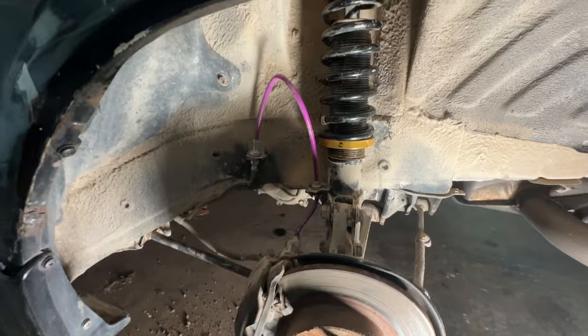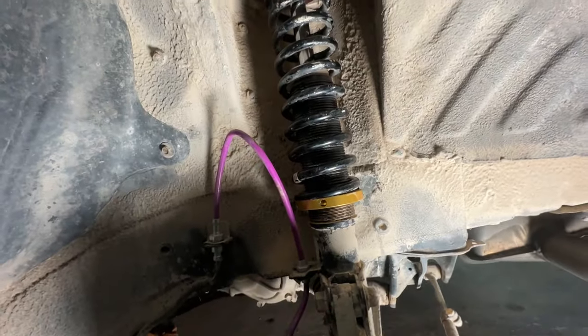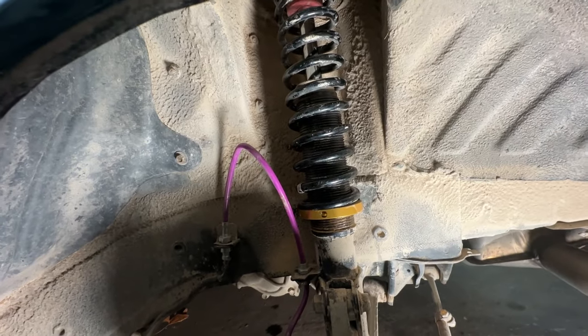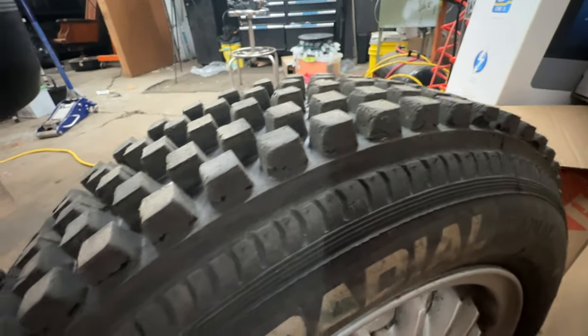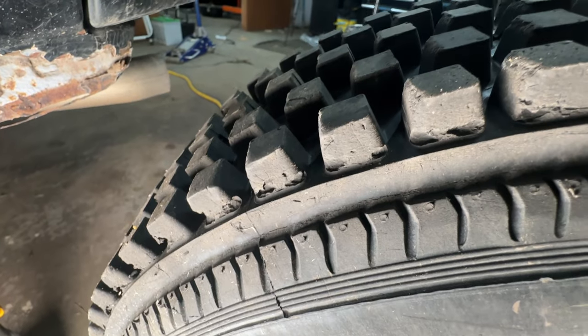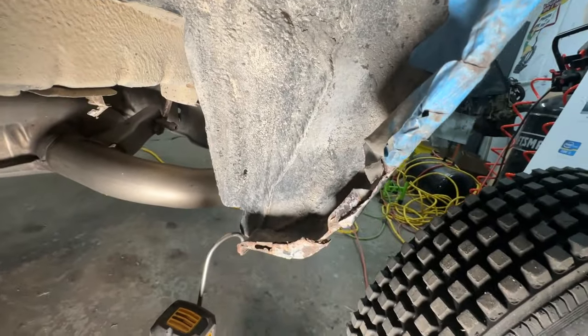Here we are at the rear of the car where we have actual adjustable suspension that will also get adjusted. We're going to dial that up as far as we can. The springs are kind of already compressed because they've got really long springs in here. So I'm going to have to either compress the springs a little bit more or use my muscles. Where we're rubbing in here, I thought it was going to be on this lip, on this jagged crap back here. From these tires we've got some chunk of chunkers. On the outside we're starting to see some splitting at the bottom of the blocks.